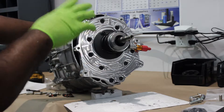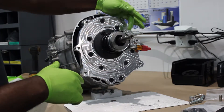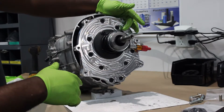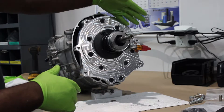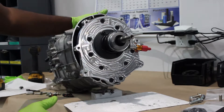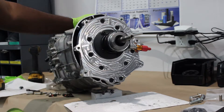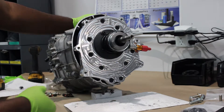The J3 bell housings, like I mentioned earlier, do have to be notched because you have less vertical height around here to offset the bell housing. So once the bell housing is down here, obviously it's going to want to interfere with these lines. I'm going to go ahead and get those marked — I'll show you a picture, notch that out, and then the bell housing will go up and be pretty much ready to go.